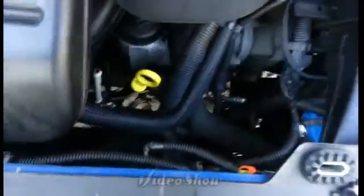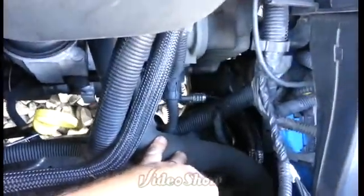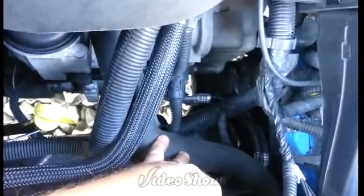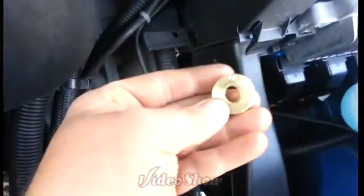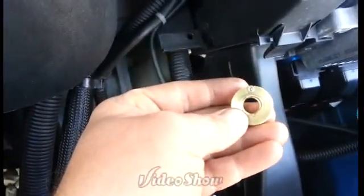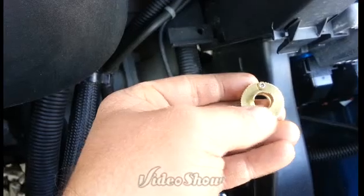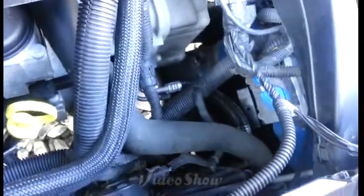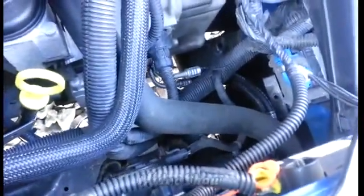One reason I had to work on the wife's car, the transmission lines for the cooler started leaking where the steel is crimped to the rubber, and I got that fixed. But I had to order me a tool. This is my jiffy type transmission line disconnect tool, guys. Had to order that because a regular disconnect tool for a fuel line or something like that won't work, because these lines got spring clips on them. But I got that done there, guys.